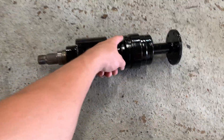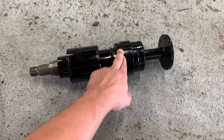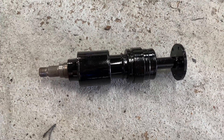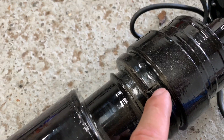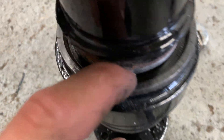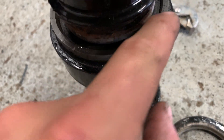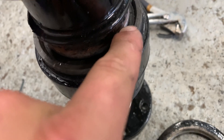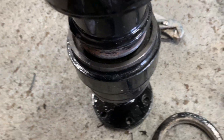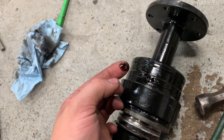I'm going to take it to my welder and have them put a big bead all around it. I'm not going to weld this myself because I want it done right. Cut a little slit here and down the side, then pry it apart with a screwdriver and pull this off. You can see it just pries up, and underneath there's a little seal that seals the freewheel mechanism. You want to weld all this metal to this metal right here, so I'll get it all cleaned up with brake cleaner.